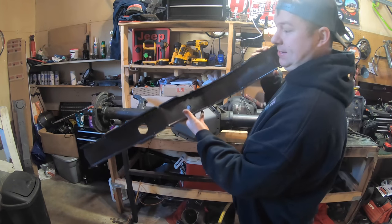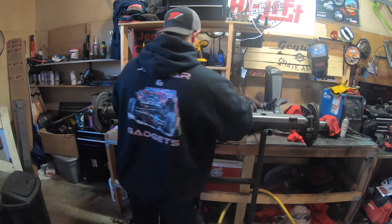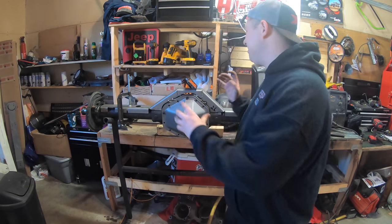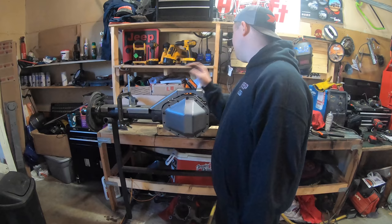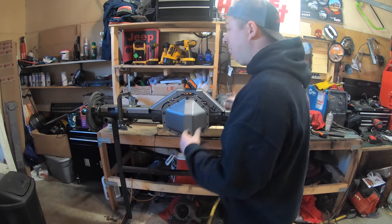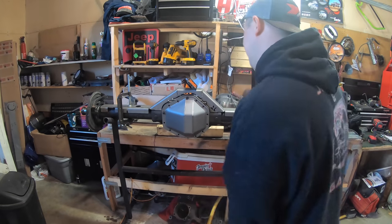The inside of the truss has been painted with Steel-It and we are good to go. Got all the edges and that full bottom plate. We're going to go ahead and put this on. Now is the time to really triple check our measurements. My OCD is starting to kick in — I keep making tiny little adjustments. Pinion angle is now at about 7.7 degrees and we do have a level top truss. Each time I loosen the clamp something changes, but pinion angle is good, we have a level truss, and it is even lengthwise. Time to tack it in place.